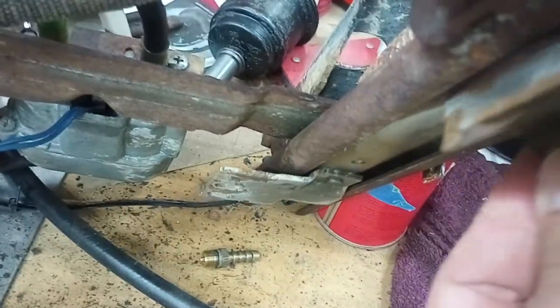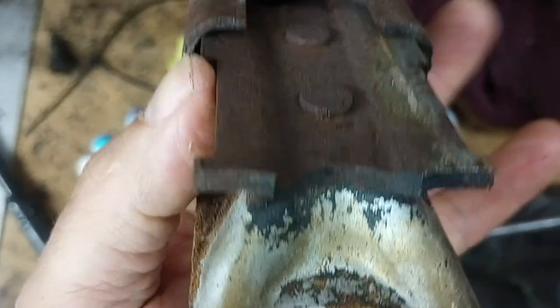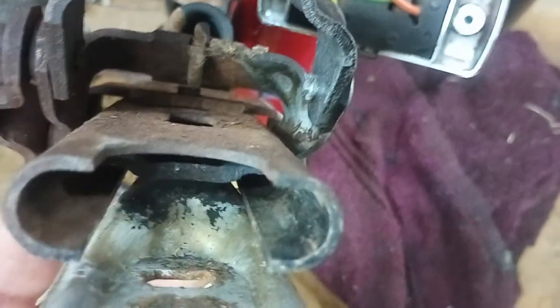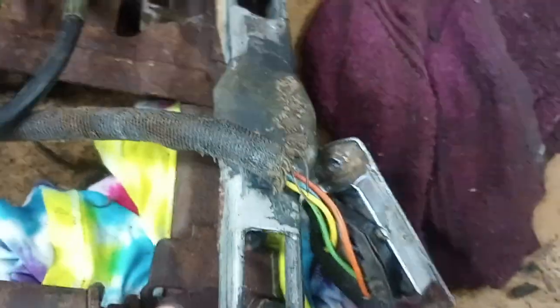This one side is like the dead side — it doesn't have a drive, it just rolls along with the driven side. I need to get some of those track sliders. Right where these little recesses are, there are little nylon clips that go on here to guide it so it doesn't rattle around, and these are missing. There's a shop that sells them on eBay — they're kind of expensive, around 18 bucks a piece — and I only need a few of them.